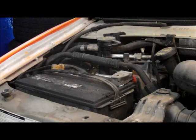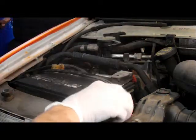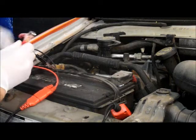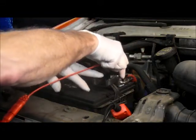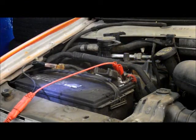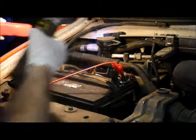By equipment, what I meant is I'm going to get my test light and check for power and ground down at the blower motor itself. We're going to have the key in the on position, connect our test light — whether it's a power probe or whatever you have — connect it up to the negative and the positive, and then go down to the blower motor and check the power and ground. Like I said, it happens a lot where the resistor burns out, but it's always a good idea to check just to make sure.